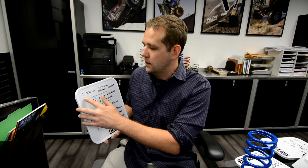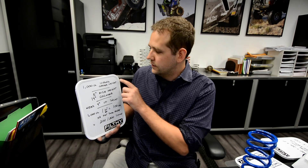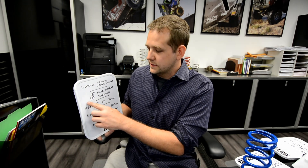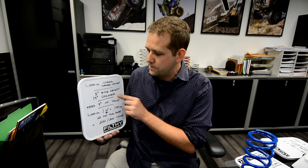That's the best way to do it — it's very reliable if you use good springs, and if your measurements are accurate to within an eighth of an inch and you do it on both sides, you'll get very close. Using those numbers, we very rarely ever have to change out springs more than once. Let's say we've found a thousand pound corner weight — that's pretty realistic; we'll see a little more on the front of a Jeep or rock crawler, and that or a little less in the rear. Remember that you don't count axles, tires, or wheels — that's all unsprung weight. We're looking for the weight that the coilovers are supporting, which is called sprung weight. So with a thousand pounds, let's say we're looking for a five inch ride height, meaning from the vehicle sitting under its own weight we want five inches of up travel. In this example we'll be using a 14 inch coilover. 14s tend to be the most common.